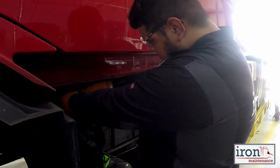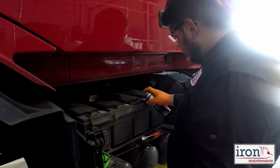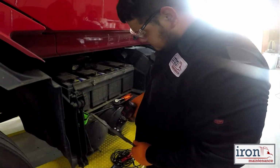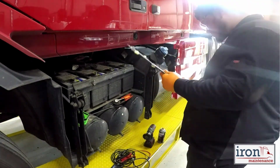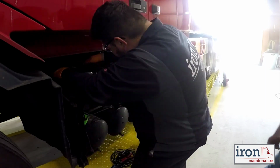When reassembling the battery pack, all the battery posts should be cleaned of any corrosion, dirt, or grease. All battery tie cables should be cleaned. All battery connections should be cleaned before assembly to the battery tie straps. Ensuring all connections are clean will help prevent voltage drops or voltage loss at the connections.